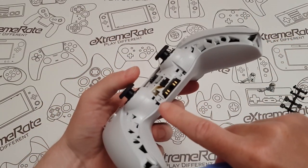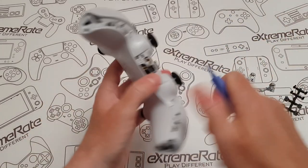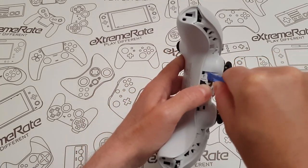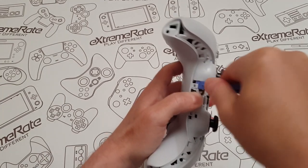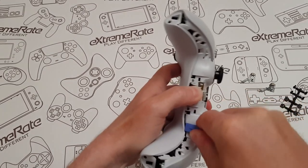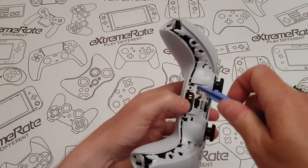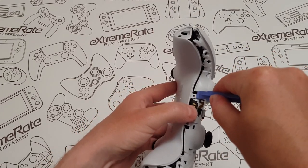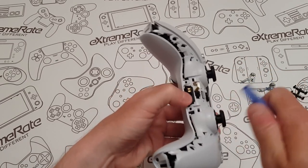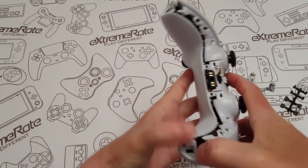Next, you've got two tiny little tabs on either side. Get your prizing tool and put it underneath — lift one side up a little bit, then the other side. Just put the prizing tool there and lift it up a little bit, using your thumb for a bit of tension. Then it opens the case and should just be a matter of cracking it open.